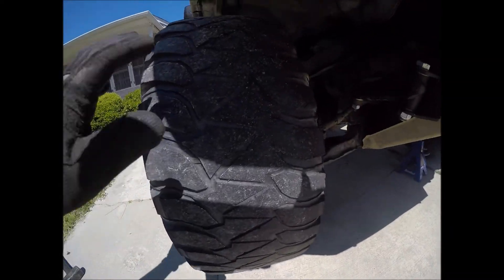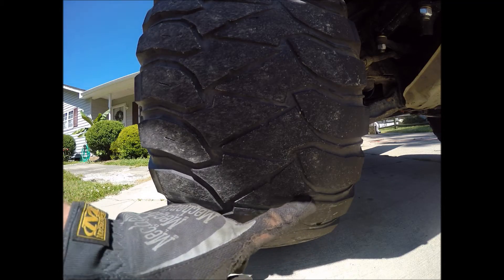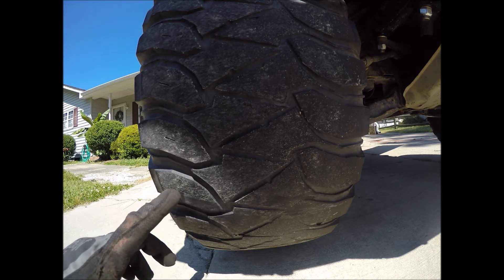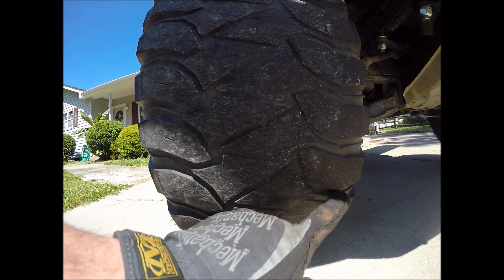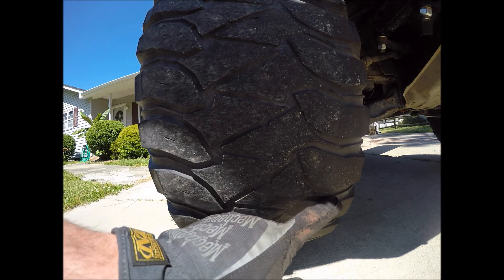If your alignment is kind of bad, I see some wear on the inside after 14 days. When I got these tires, they were half treads — keep that in mind. So the outside still looks like half treads, but the inside looks more like one-third or one-quarter tread.